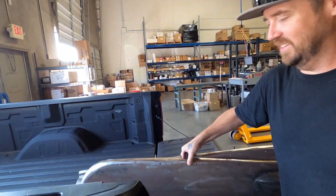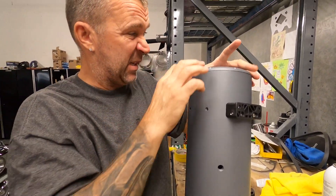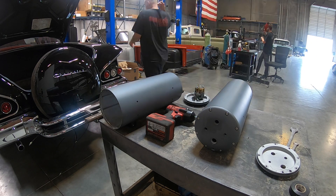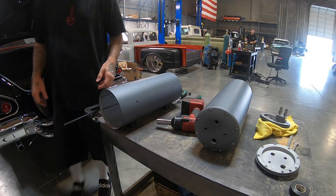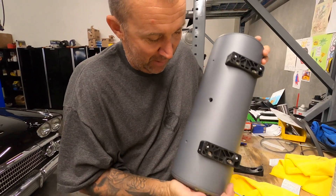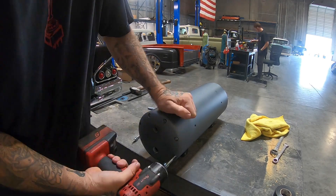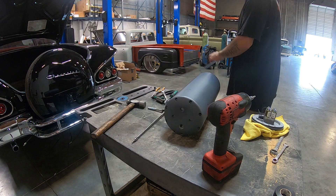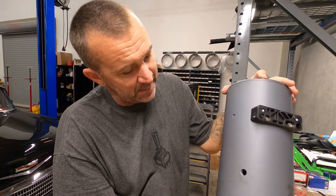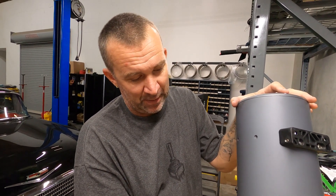Over at the Candy Shop, just going to take these cruiser skirts over for bodywork and paint. I had to do a few things to the tanks — I had to reverse the caps on one side to keep the bolt holes lined up the way we wanted to look. I glued some nuts in there for mounting so I can access them easier because of the way I made my mount, and that's just putting the feet back on. When you're painting the AccuAir tank, there's not a lot of prep. As long as the Cerakote seems good — some had peeling issues where you'd want to go all the way down — but these ones we just do a real good sand, then start with an etch primer, then a sealer, then base and artwork. It depends on how far you're going with intercoat layers of clear.